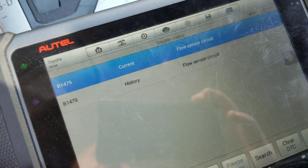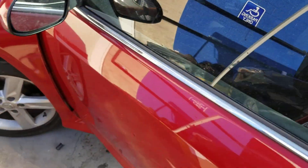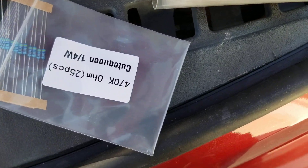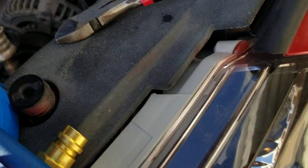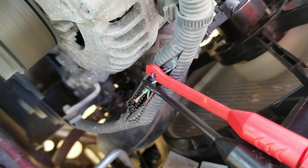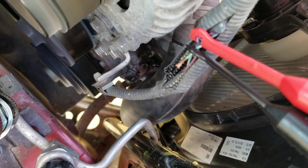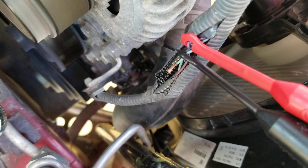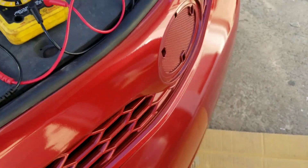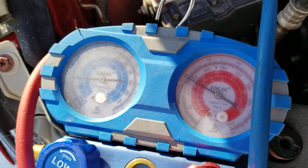With my procedure you don't need to do that. The AC works — I didn't reset the scanner or send a signal manually. What I did was use a 470K resistor with this wiring. Just follow this procedure: from here, no need to go underneath. You have purple ground, light green, and light blue. Just disconnect the light green from the compressor and use the resistor between the light green and purple — the 470K resistor — and the AC works normally.